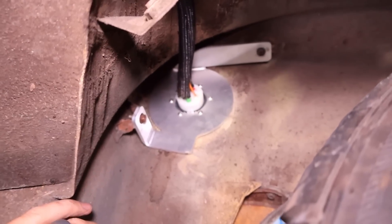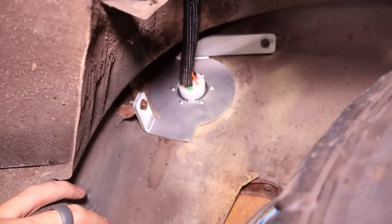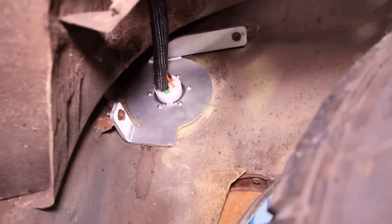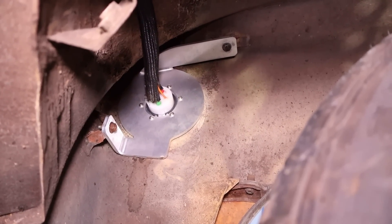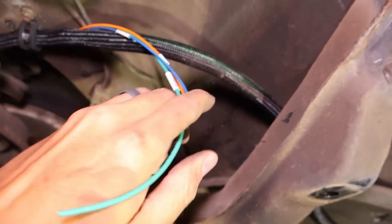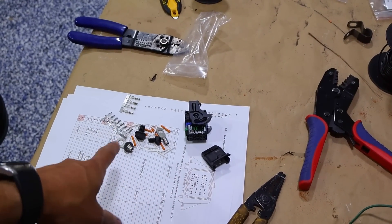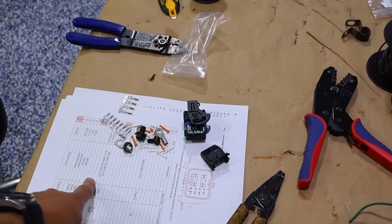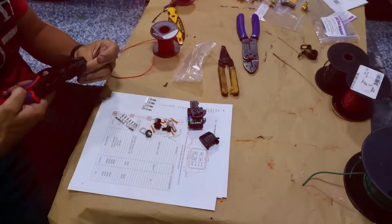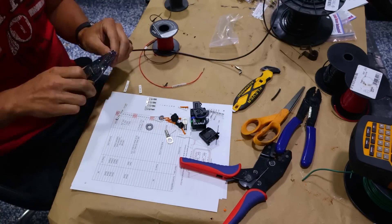It's going up over the subframe. I think I've got some large heat shrink that I might put over that just to make a good connection, or just use some tape. That's mounted. All the wiring here is done. We've got some low voltage wires — this one actually goes to the VCU, not to the charger, so we'll route that later when we're wiring things for the VCU. I've got the wiring diagram or the pinout here, and we're going to hook up the connectors and wires for the combined charging unit. This is all the low voltage stuff like the CAN wires, communication wires, wake up, things like that.